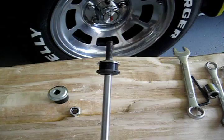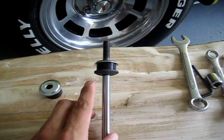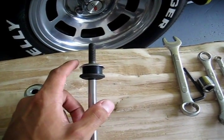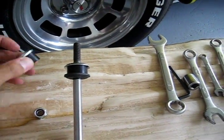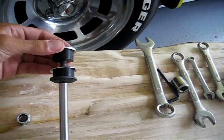Here's just a little image of what it looks like when everything's on the shock. These are the ones you'd have to put on before you install the shock: thick black one, bushing, thin silver one, then you'd have the A-arm, and then these two would go right on the end like that, along with the nut.